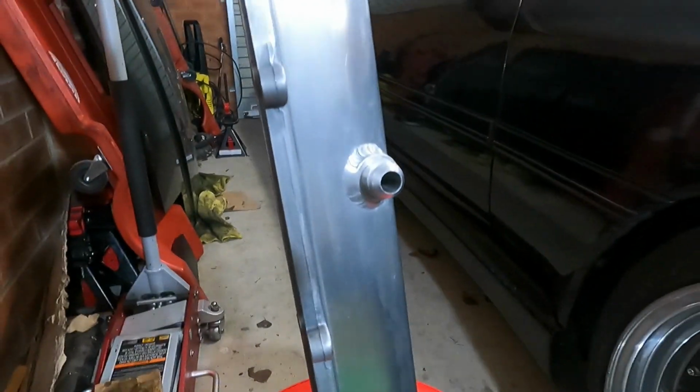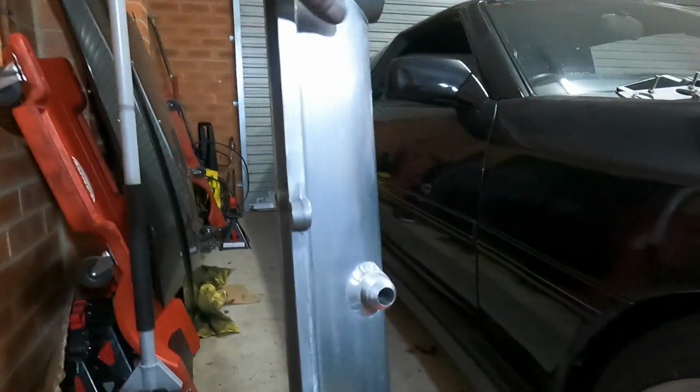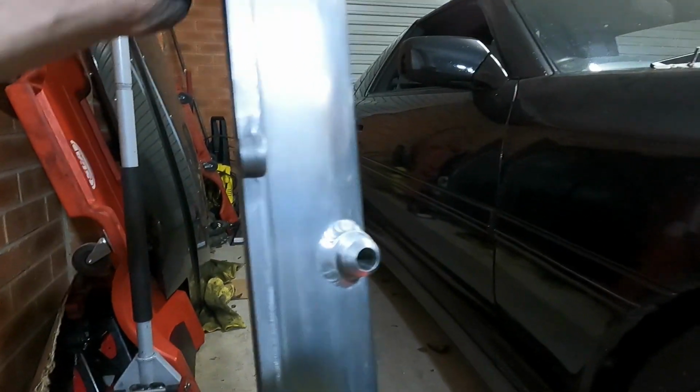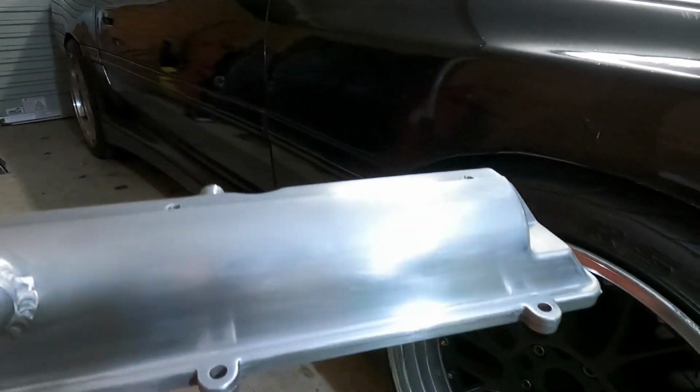Because if you go up to like a 1200 but you haven't done the earlier grits properly, then it's definitely still going to have those deeper scratches. Still got 800 grit and then 1200 to go.